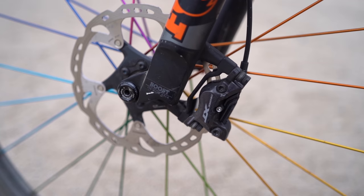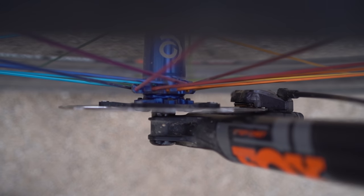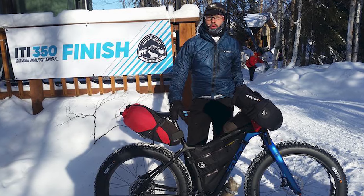So what is the best brake type? It depends — but nine times out of ten I'm using a hydraulic brake because it's much easier on the hands, with more stopping power and feathering capabilities. I do accept that if something fails, I might lose a brake, since hydraulic brakes are basically impossible to repair in the field. I've used hydraulic brakes on international riding, extremely remote stateside bikepacking, and even in Alaska pedaling in negative 40-degree temperatures. The one scenario where I'd consider a mechanical brake is world touring — going somewhere so remote that parts or a brake bleed just might not be available.